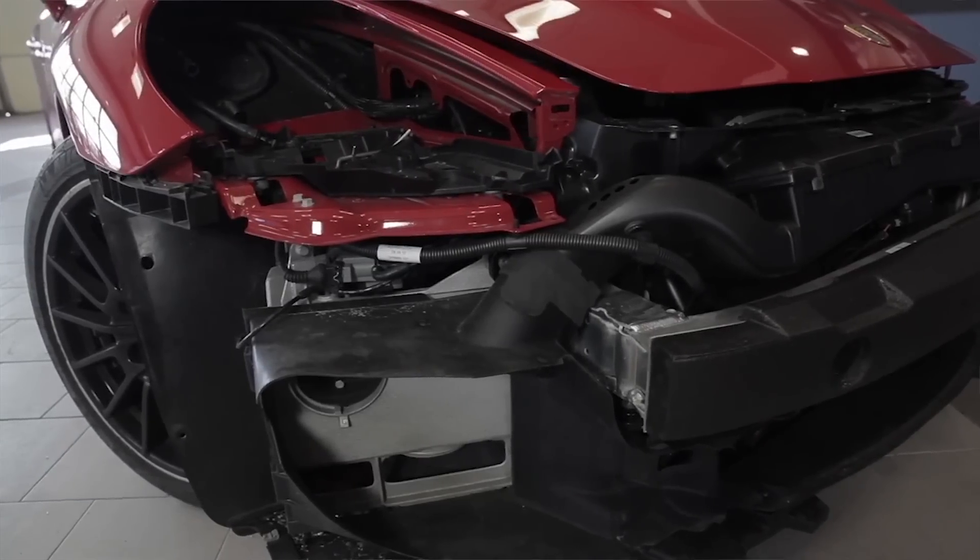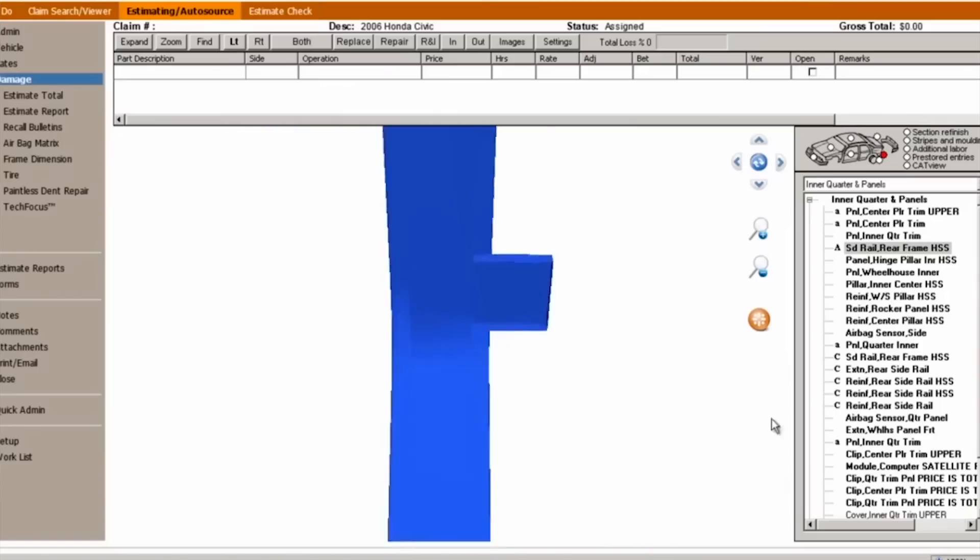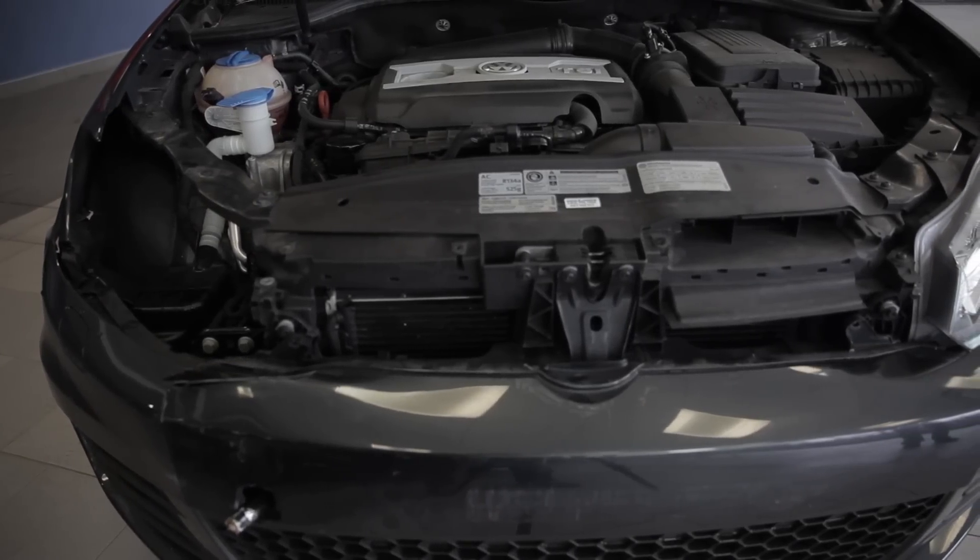As a damage assessor, when you look at the car, start in the opposite area of the damage — that's what I try to teach all the time. We know where the car is damaged; if it's hit in the left front corner area, start with the right rear tail light and work your way back in. Find the stuff that's undamaged, work through that, then get to the harder area. Once you get there, do some quick checks and quick measurements. If you verify structural damage, that's when you want to pre-measure the car during the blueprint, triage, or x-ray portion, then get the car taken apart so you can see what's there.